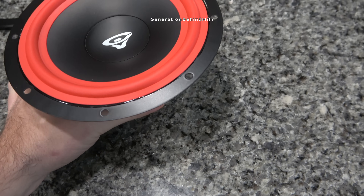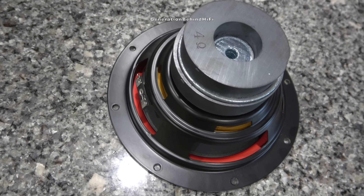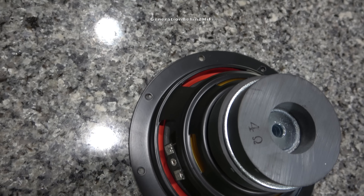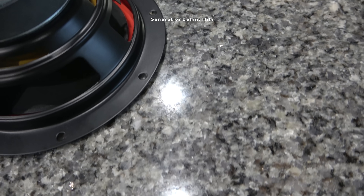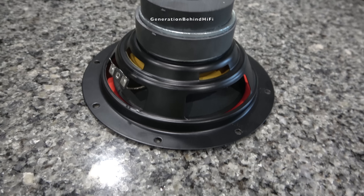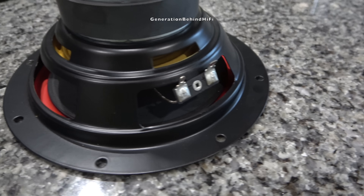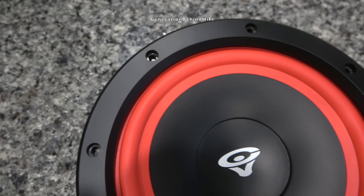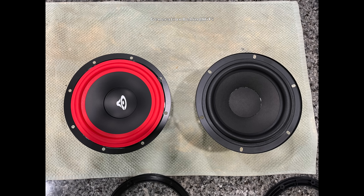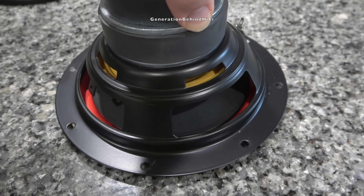The driver in the LA165 is pretty good for this price point. It has a 1 inch voice coil and utilizes a vented pole piece, which helps cool the voice coil and releases trapped air behind the dust cap during long strokes. Cerwin Vega is also venting the voice coil underneath the spider, which will help keep the voice coil cool during long and loud listening sessions. The driver utilizes a butyl rubber surround and the cone material appears to be paper mixed with some type of composite or glass fiber material to enhance strength and rigidity. Simply put, a very respectable driver for this price point.